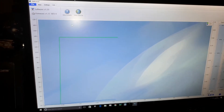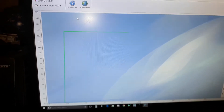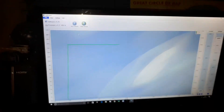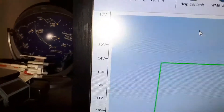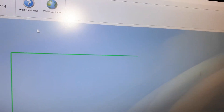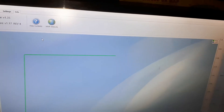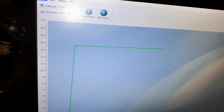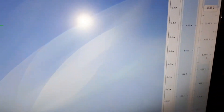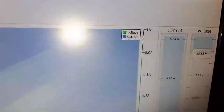This is the software — relatively easy to install. Running Windows 10 on a fairly up-to-date PC and it seems to be working okay. What we've got at the moment is a line monitoring the voltage, which is showing just below 14 volts — 13.8 volts — a steady floor. We can see there's a perfectly smooth power supply reading, and it don't look like there's any problems there. On this side we've got the readout which is the same as what's on the actual device. Obviously the computer screen is handy if your device is in a place which is not visible, but I've mounted mine in a visible location.